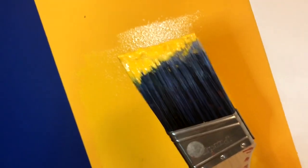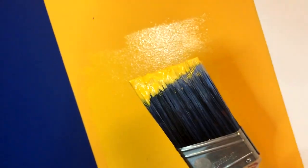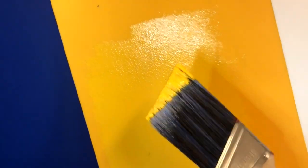The other technique is using a brush to touch up a couple of spots. Load your brush up with a little bit of paint — you never really want to get more than you need on the paintbrush, as it's going to be a lot easier to control if just the tips of your bristles are wet. When you do a brush touch-up, start from the center of your touch-up spot and do kind of a starburst pattern. You're using those brush tips to try to blend it into the paint around it. Make the spot as small as possible while still bringing it out far enough to blend into the surrounding paint.